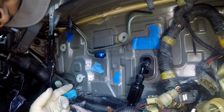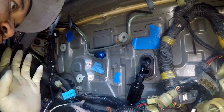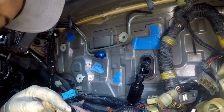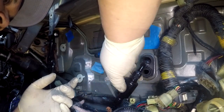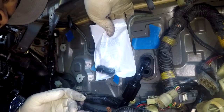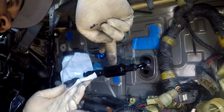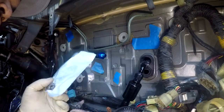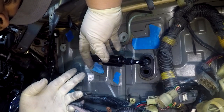and then you can route your fuel line however you want from that fitting on your filter to the fuel rail. Now if you do it this way, depending on your filter, some filters come with different inlets and outlets. In this case, it's now converted to a -6. You would then need a -6 to -6 female to adapt to the fuel filter, which is a -6 male, and then run into your fuel rail. This way has too much goddamn fitting, so this time around, like I said, I am going to be doing it with the compression fitting.